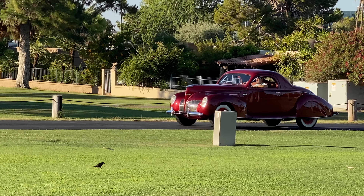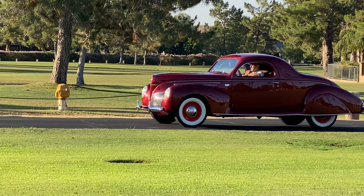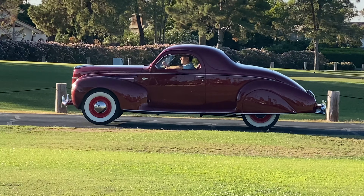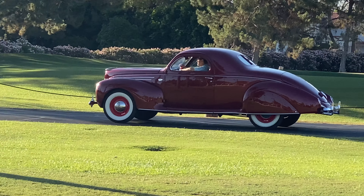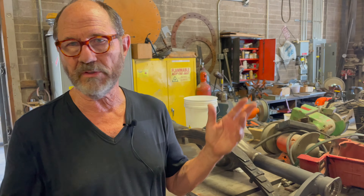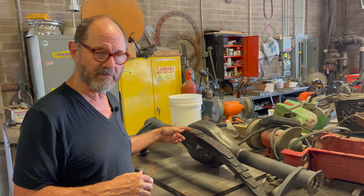The point is that the car should sit almost exactly level. It should sit down and have a tiny bit of bias so that the front is just a tiny bit lower than the rear. That's hard to achieve unless you've done it a lot — because once you do all this work, it's going to sit where it sits. These guys have been doing it for 30 years, so they know where it's going to go, how many springs to take out, and how many to move.